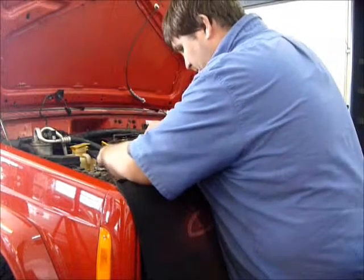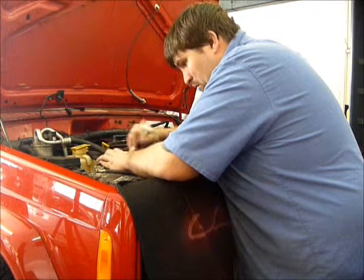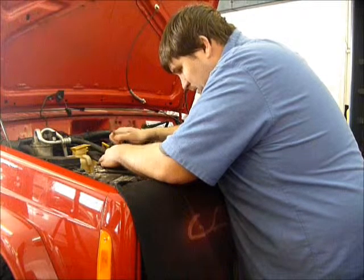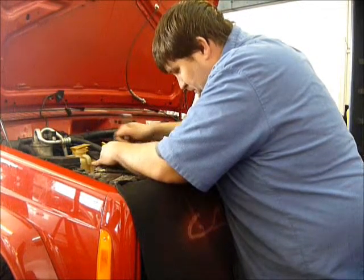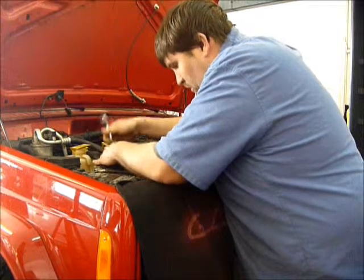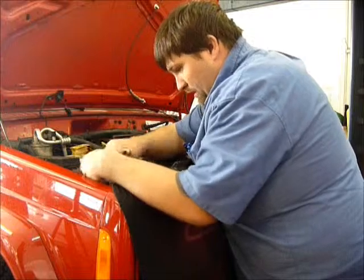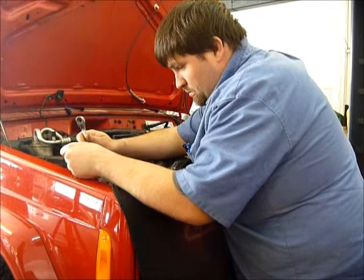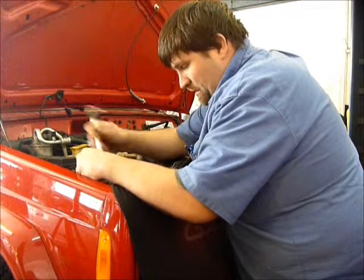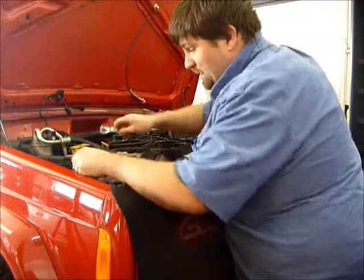These terminals are a little nasty looking, so I was hoping that I'd leave them loose in case I have to disconnect it, because the vehicle does have a remote start system built into it, and sometimes with a remote start system, once you restore power to the car, it will automatically start cranking. It's not what we want. Okay, I just tightened the terminals down a bit, and I heard the locks go off again, so now the battery's not dead. Just had to tighten the connection.